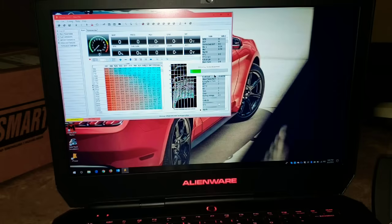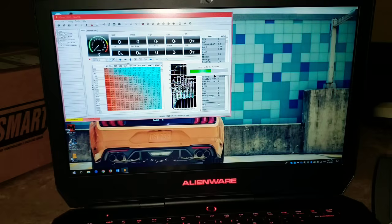One side note: after the flash is complete, the car is going to go haywire — all the sensors are going to go off. You have to drive the car so that all the sensor warnings on the dashboard go away. It's a little scary at the beginning, but the more you drive, power off, and power back on, those warnings will start clearing. One that scared me the most was my transmission — it wouldn't pass gear 1. I drove carefully on a safe road, powered the car off and back on about twice, and all warnings went away. Your car has to relearn everything: acceleration, transmission timing, and all sensors including LKS.